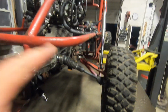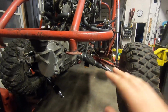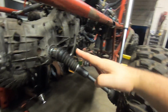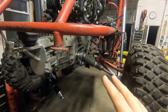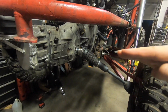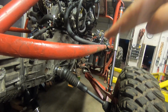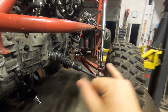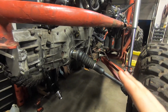So now I start to develop a theory of what I think happened here. Watching the videos and driving it, when I'm on the throttle and this thing's leaning, these axles are actually pretty straight with the transmission. They've only got a little bit of forward angle. And one thing that I observed when building this is that we are very close to running out of travel when we're actually totally straight. So the axle is in its longest form right now. It goes shorter, shorter, shorter, and then longer, longer, longer as travel goes up. There is that sweet spot in the center where we are at our shortest point. And I have it so maybe there was a quarter inch of actual travel left before that axle bottoms out. And I didn't think too much of it at the time.